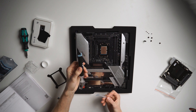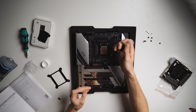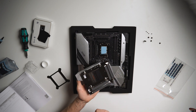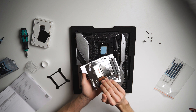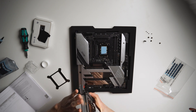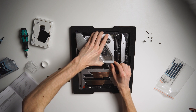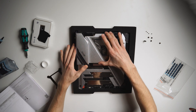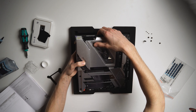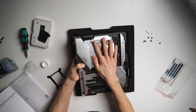We're going to use some high quality thermal paste — I'm using the KPX — and I'm going to spread it completely with the application tool. I've applied the thermal paste and the next step is to mount our monoblock. You can read the warning and we have to peel off this label. The block is really heavy and it will spread the thermal paste almost by itself. But we obviously have to mount it. You want to place one of your hands on the block that way it won't fall off.